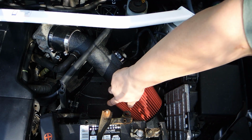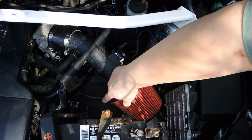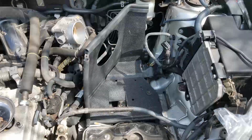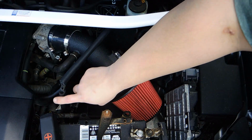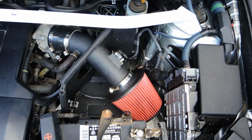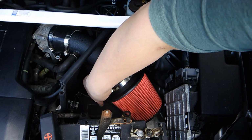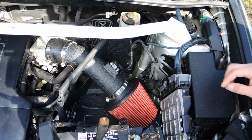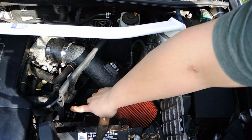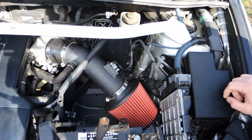To improve it, you'll notice in this photograph that there is a square hole right about here. To utilize that hole to my advantage, I take the leftover scrap metal from taking this off and make a splice plate, which you can actually see right here. I drilled a hole in the center and it lined up perfectly and it holds this down, so it's got some decent strength there. You also have to re-drill a hole for the mounting of this valve, which you just plug with two vacuum caps that come with the kit.